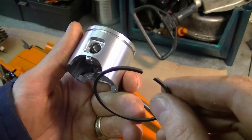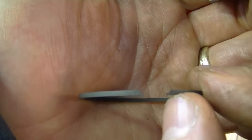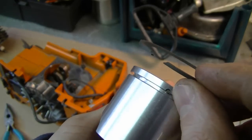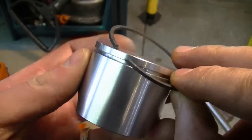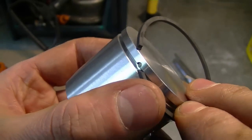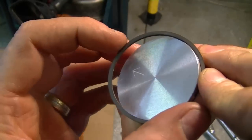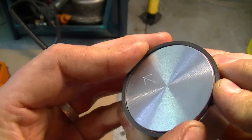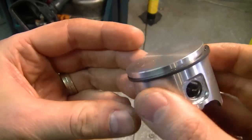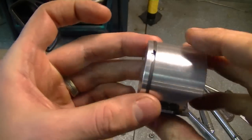Now the next thing you want to install is the piston ring onto the piston. You're going to see at both tips of the ring that it's shaped like this. You want this side of the ring to be down where the piston pin is. Now I'm going to start by putting the end of the ring right at the tip of the pin here, just like that. Hold the ring there, then gently expand the ring over the piston and it's going to fall right into the groove. If you expand the ring too much, it's going to snap because they are very brittle.